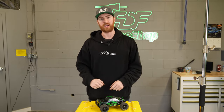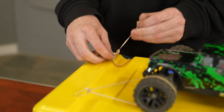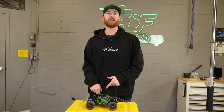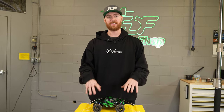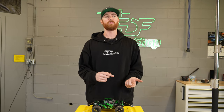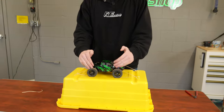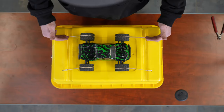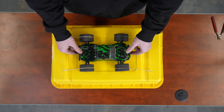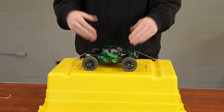Let's configure this in the proper way. We've set up the second configuration — this is the best iteration you can set up. There are three or four acceptable options I'll show you on my pro car as well. This best setup has four wheels connected to the trailer in opposing directions and attached to the wheel. The reason you want to attach to the wheel is because as the trailer articulates over bumps, both the trailer suspension and car suspension can be used to absorb bumps without disrupting strap tension.